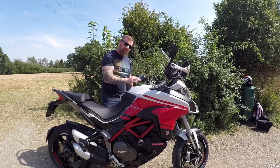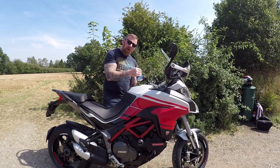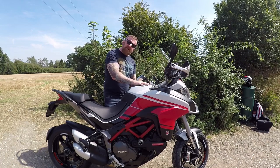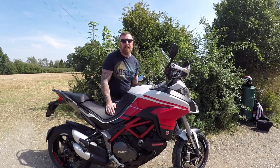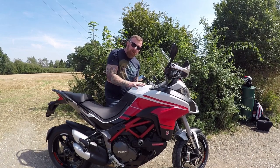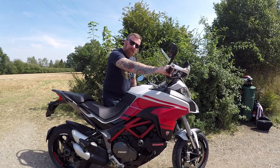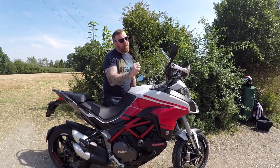When you get into the computer — they do call it something like Ducati ICU — you can change the settings. So low is probably 100bhp and high is going to be 160bhp. I'm running this in urban at medium, so let's call it 130bhp unless someone tells me otherwise. I'm finding that quite enjoyable — a little bit of meaty power. The throttle response in urban isn't as angry or urgent; I'm quite enjoying it. It's nice to whack open the throttle and not feel like you're going to lose control.